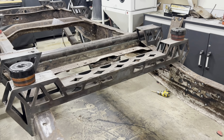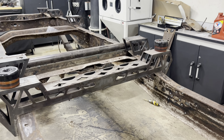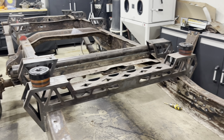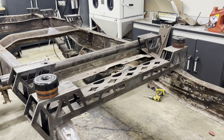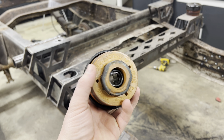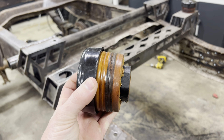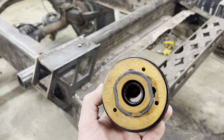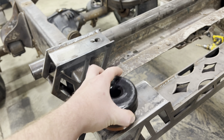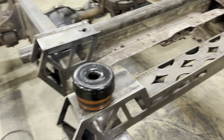So this is the rear cab mount — it's one solid piece that drops right over the frame and welds on both sides. It captures both rear cab mounts into one. It's set up to use the early super duty style cab mount bushings — I think it's like '99 to 2007 style. It has this keyed shape cut into the plate so it locks into place and can't turn.